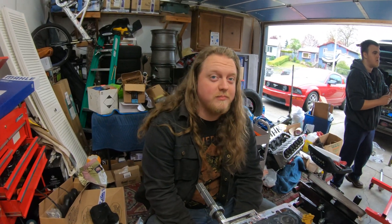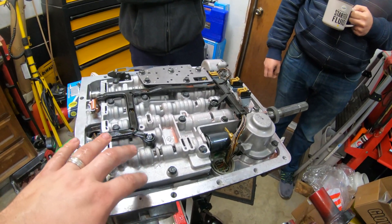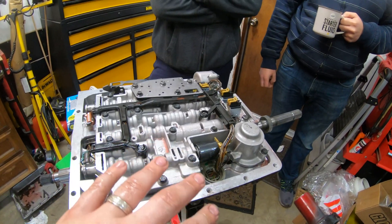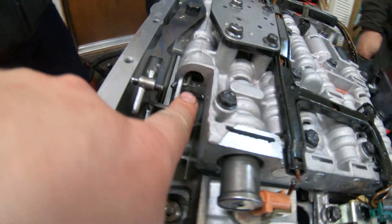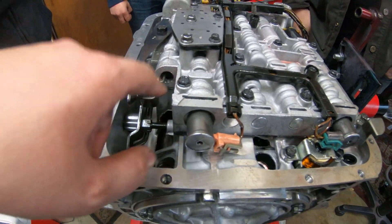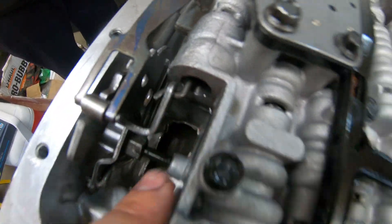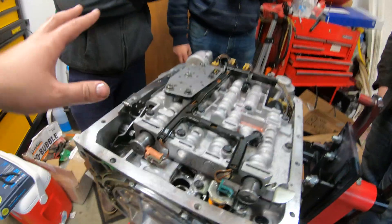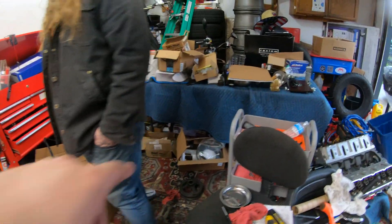Alright guys, we just finished with the whole shift kit. We just wanted to get it done. Layering it back on basically went: gasket, the metal sheet that we had drilled, another gasket, and then the accumulator. Useful tip — the shifter selector is really hard to get back on. You actually want to get this hooked up before you bolt down the valve body. We were working on this and I accidentally dropped this little pin part and it fell inside the transmission, so we had to take it apart again — that was annoying. But we got it done and it is now back together. Got all the electronics plugged in — we're only missing the clip for one solenoid.